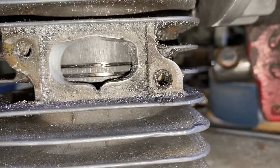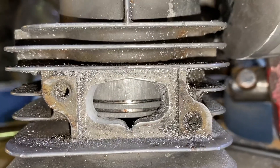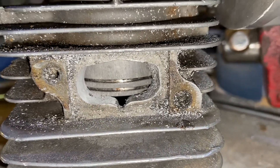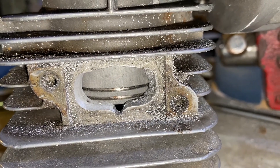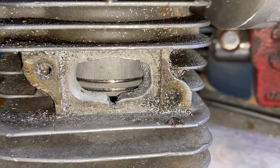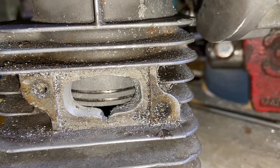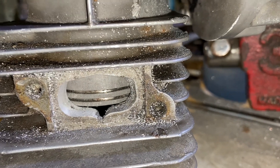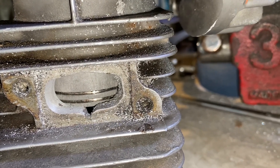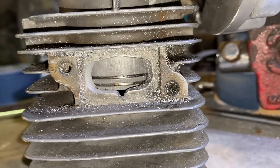I'm trying not to raise it, at least not a whole lot — just a bare minimum. Now as far as the timing number, it's hard to tell you what timing number it is because of that little lip they've got down there. I can tell you this point is about here — right about here is where I'm at about 20 degrees of blowdown. And if I take it to here, this is about 17 degrees of blowdown right in this zone. So it's kind of hard to say where my blowdown number is going to be because it's hard to factor in that little thing they've got in there.